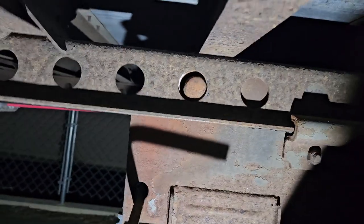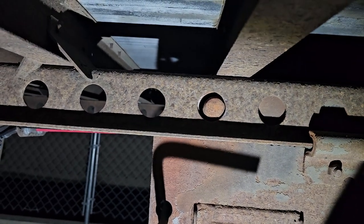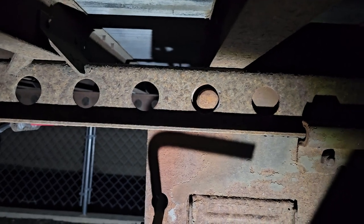When you pull it up and come back here, you can see exactly how many holes you've moved — like, 'I've moved five holes but I only need three,' so now you need to back up a little bit, or vice versa. Once you've finished and got it slid right next to the hole you need, with the manual style like the one I've been showing you, you'll just smack up on it and it'll pop back in there and the pins will push out. Then you need to get back in the truck and move it a little bit whichever way you need for those pins to latch. Don't forget to do this — you don't want to be driving down the road and when you hit your brakes, these tandems slam into the back of the trailer.